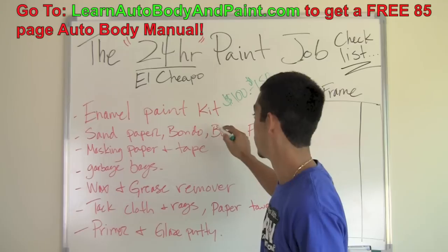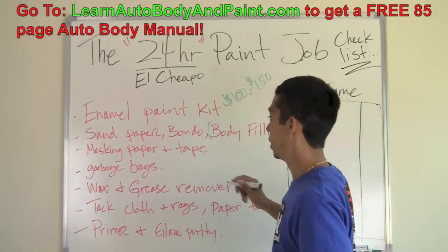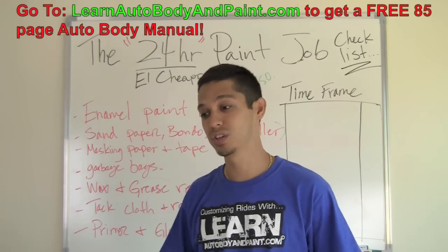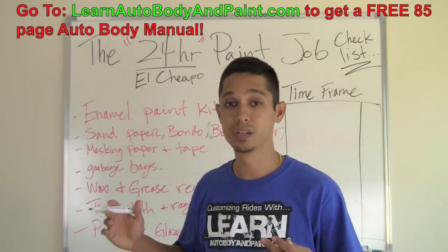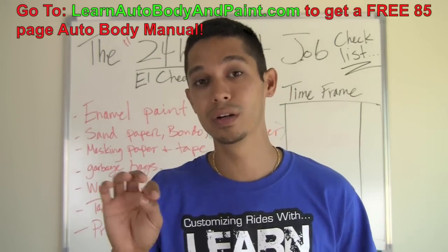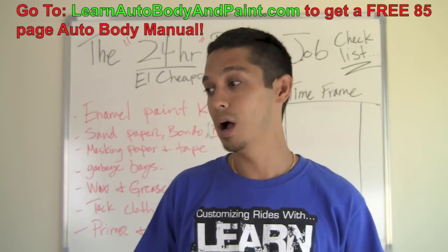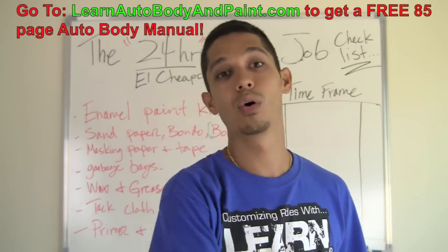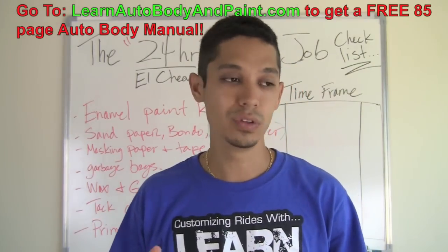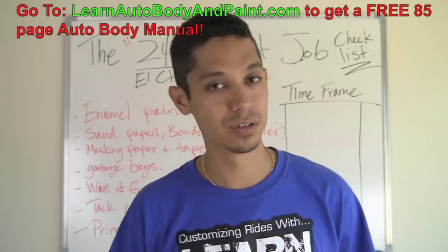You're going to need some sandpaper and bondo, which is body filler, if you're going to be doing some minor dents. If you've got no dents or you're just going to paint right over light dents, you don't need any of this. But if you want to fill a couple of dents quick, mix up some bondo — make sure your dented areas are sanded. Fill them, go around the whole car; that'll take about 15 to 20 minutes. Let that dry 15 to 30 minutes, then hit it. Go all around the car — that'll take another 30 minutes to flatten out all those areas. Then prime them quick with a 2K primer, not a lacquer primer, just to fill in your scratches. You can water sand with a DA using about 280 grit.